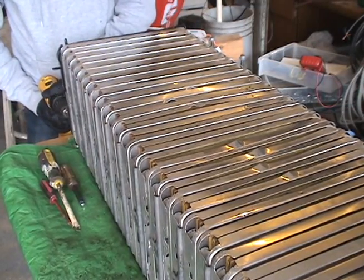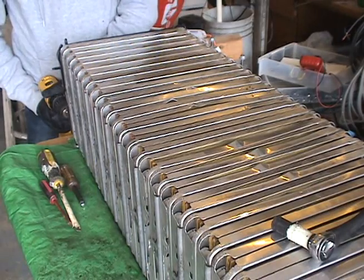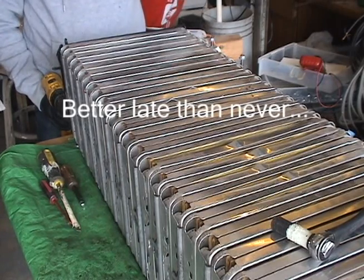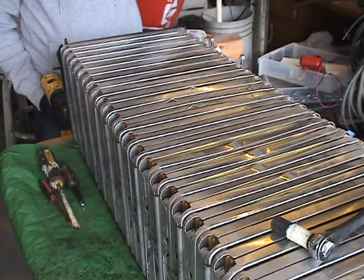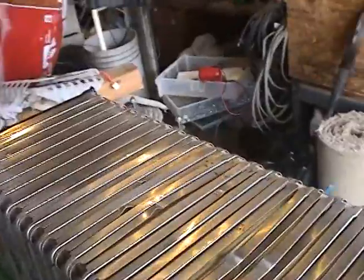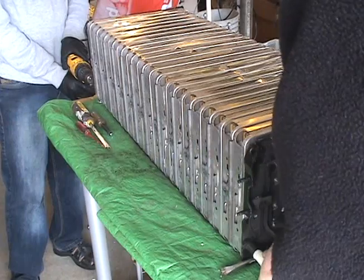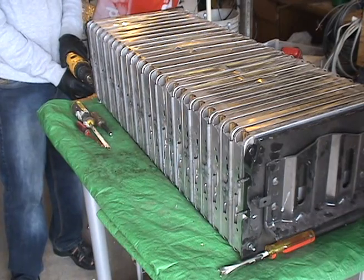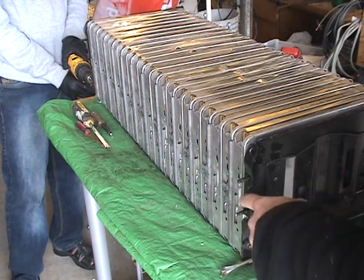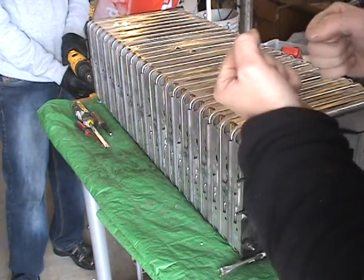We should be careful — these could actually burst and spray us with lithium, which will not be good. You can see how it is curved, and how just by taking the pressure off that one there, it's bulged out. What we should do before I get down to the last half turn is clamp this together so that we can release it slowly.